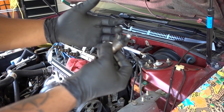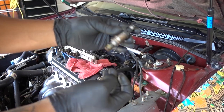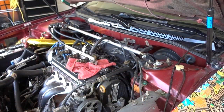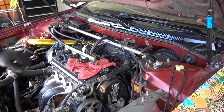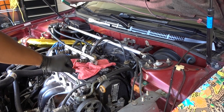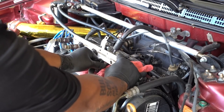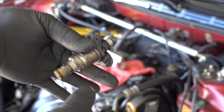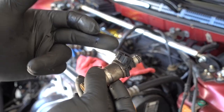My injectors are in pretty good shape but because I removed them, I'm probably going to have leaks if I put them back on like that. So I'm going to replace all the old rings on the fuel injectors. Everything looks really good and clean where the injectors go. Because we don't have to remove the fuel rail we don't have to disconnect anything else. I'm going to remove them one by one so I can swap all the old rings — I don't want to remove them all and have them mixed up. I'm going to put them back where they belong, this is why I'm doing one by one.